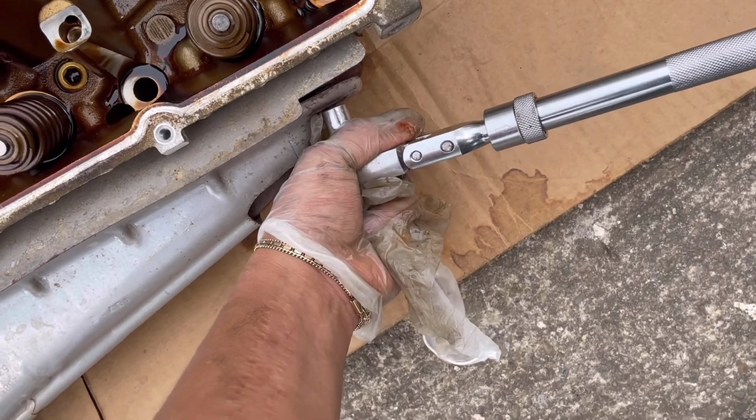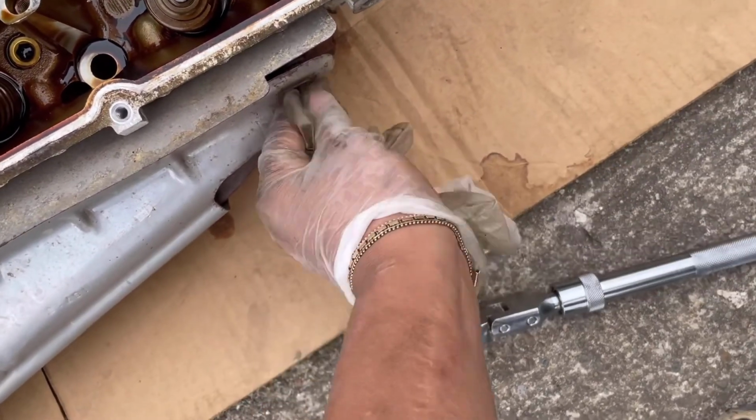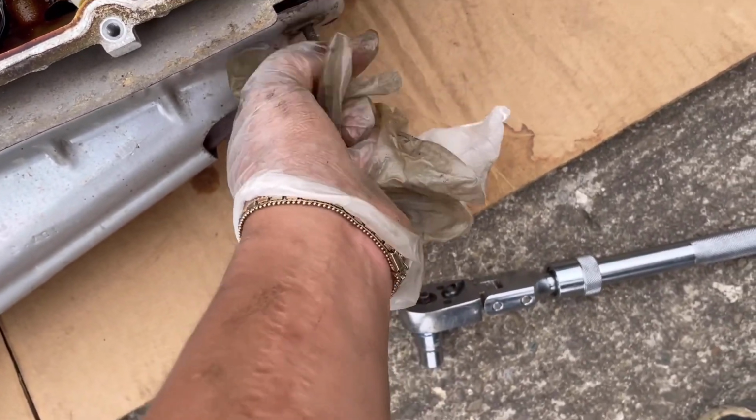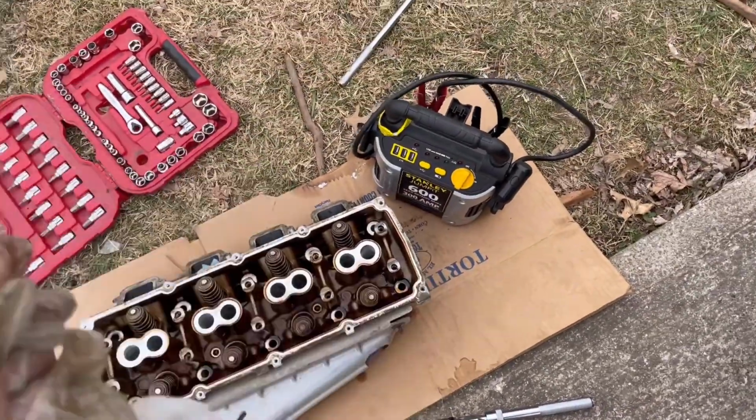Basically right here, I'm just talking about how the bolts are really rusted. Trust me guys, just use heat, use a torch. It's your best friend. Try to maybe use the lubricant, the PB Blaster, but just use the torch, and trust me, those bolts will come out, which I'll show in the next video.